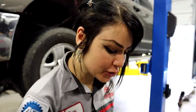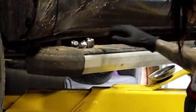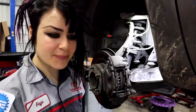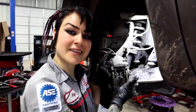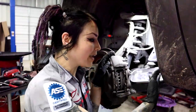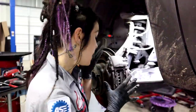Now I've got my 22mm socket to remove these wheels. Most larger Toyota vehicles use a 22, and the smaller ones use a 21. All right, so let's get to work. The first thing I'm gonna do is grab my magnetic tray and place it right there, ready to accept my parts. The second thing I'm gonna do — if this is the first time doing brakes like this — I'll take a picture of how things look so that when I put things back together it's normal. I also recommend that if this is the first time doing brakes like this, you do one side first and then the other side so you can go back and compare and contrast.